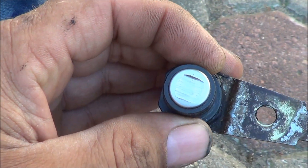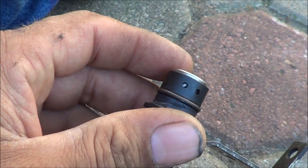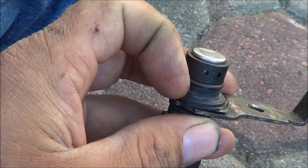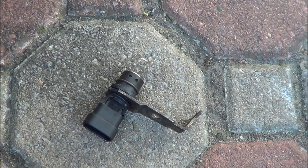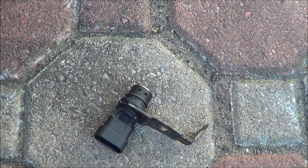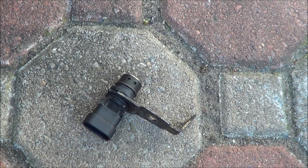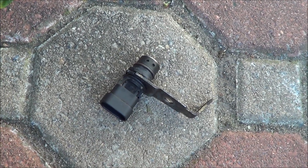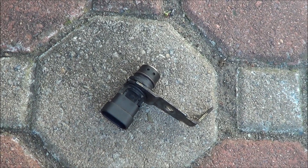What I've found is that GM actually makes a shim, and the shim is five thousandths a piece. There's actually a GM service bulletin on this that tells you that if you have a vehicle that's got an intermittent miss, or shuts on and off under power, like at two or three thousand RPM, then this is one probable cause to look for.